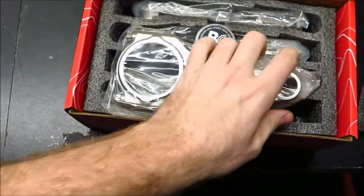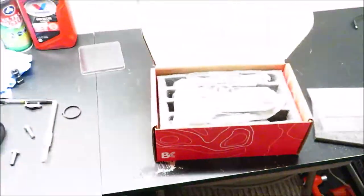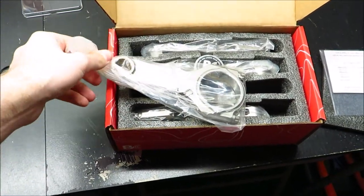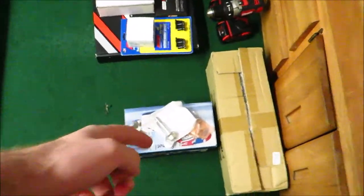These are very good quality connecting rods. Turns out they are already really well balanced. A lot of stuff like your pistons is balanced, but it's within two grams, which is the industry standard. These ones, when I weighed them out, were all within a quarter of a gram — even better than what I was trying to get the pistons to. With the pistons, my goal was to get within half a gram of each other, because anything less than half a gram doesn't really show benefits for engine smoothness.